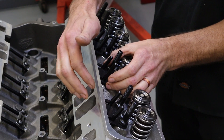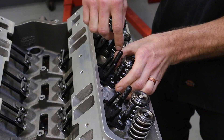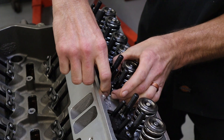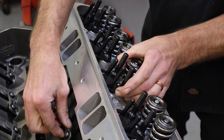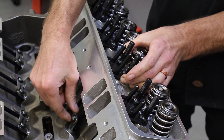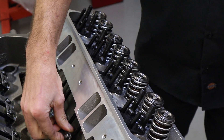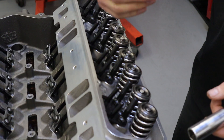It can touch the head as long as there's enough room for oil to lube the push rod, since it moves in the guide plate — but you don't want the guide plate shoved over cramming it against the head. The exhaust on these particular cylinder heads have plenty of room; it's the intake ports that are the problem. I want to tighten the exhaust stud first because it'll roll the guide plate over as you tighten it. Pull it up, bring it over a bit, make sure the push rod can move up and down freely, then snug these down.